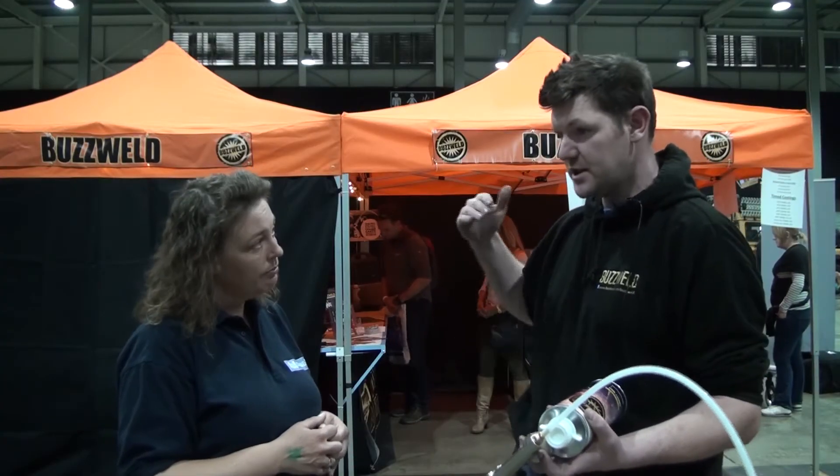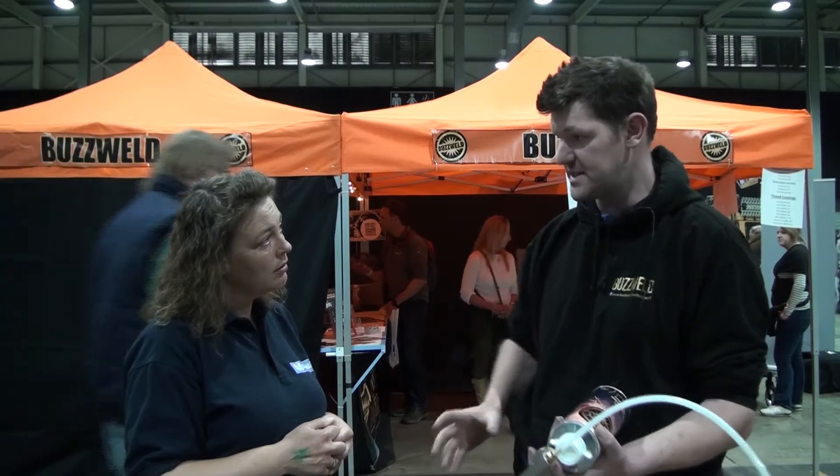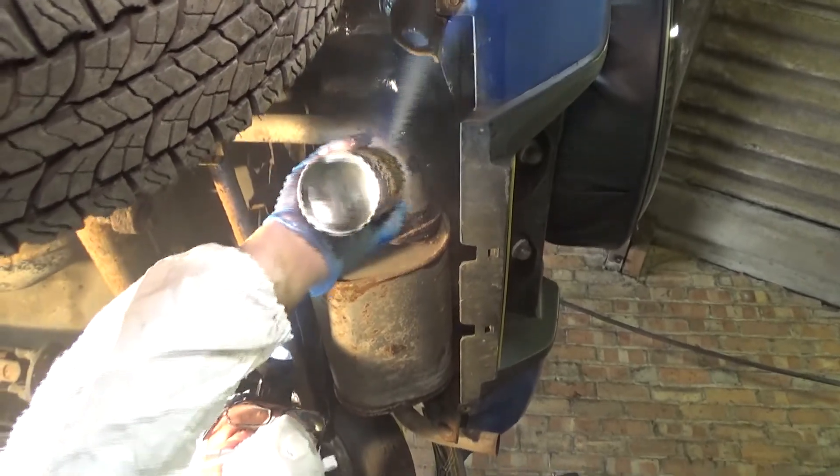Then you put a wax on top — that's a belt-and-braces approach. If we do a challenge truck and they just want it to last and don't want to come back to that area again, we'll do two doses of cavity paint and then Zero Prep or WAR on top of that. That's pretty much an almost fit-and-forget solution.